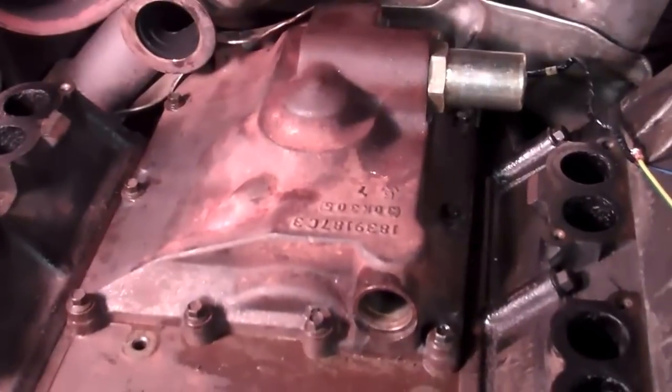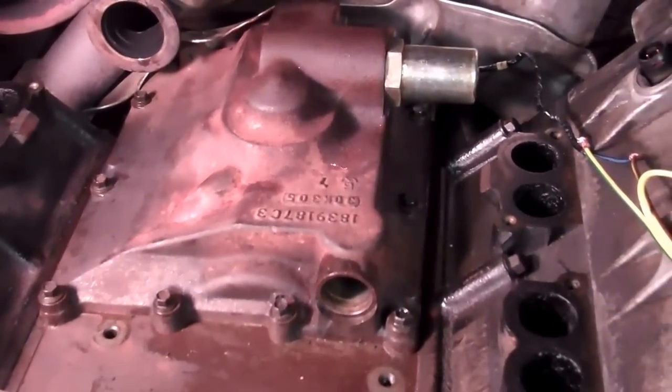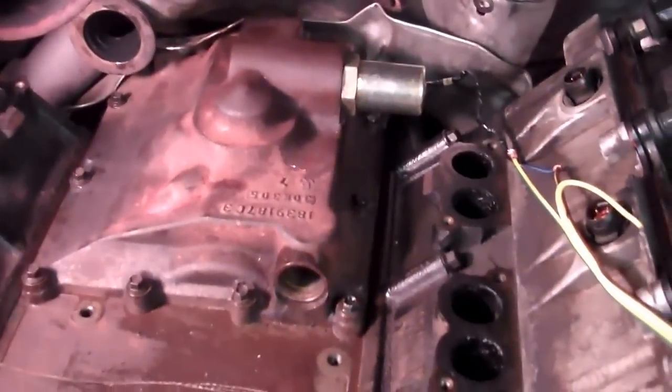We're still working on this F-250. We have replaced the o-ring seal that was blown apart inside the H-pop, and the discharge tube to H-pop connection — got that replaced, got the H-pop cover back on, got it wired back up, and we're doing an air test to make sure that we've corrected the problem.